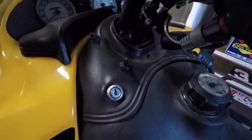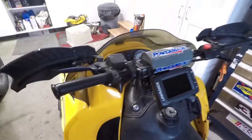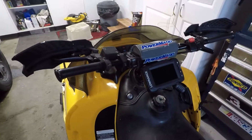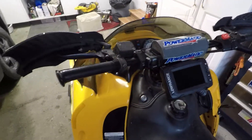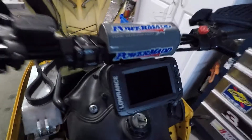In this case, I don't have electric start on this sled. I do have a key but it doesn't do anything other than allow you to turn the ignition on or off. If you did have a sled with electric start, that means you'd have a 12 volt battery on it and wiring up electronics to 12 volts DC is no problem. But when we're putting out 12 volts AC off the motor, unfortunately our electronics aren't going to run off of that.